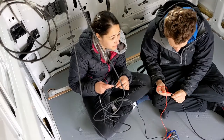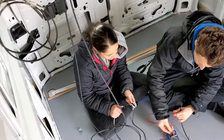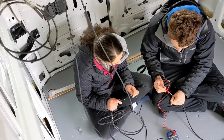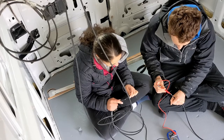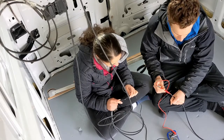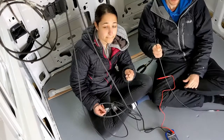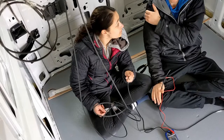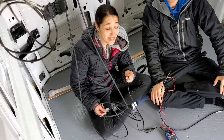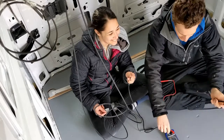I mean, the sun is out. The sun is out. And then we'll just do a quick amperage one. Ooh, sparks. Yeah, sparks on me as well. 3.4 amps. 3.78. It's just going up and up. Which should be plenty enough to charge our batteries from. Lovely. At least in sunny weather like this. At least in sunny weather, which I'm sure there'll be plenty of in the snow.